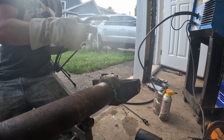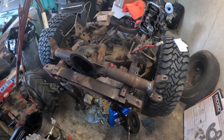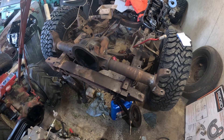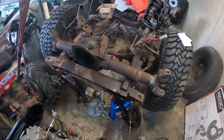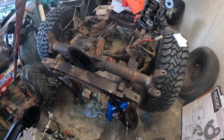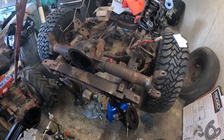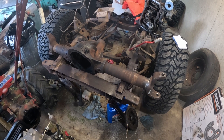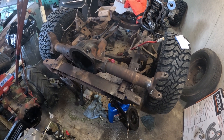I'm just going to rotate it to the other side and give it a tack there too. There we go — there is our Dana 44 shortened down. It'll be 53 inches once I've got all the other hardware on. I really did not believe how short this turned out — that pumpkin looks gigantic. I had to come move it over and double-check my math, but yeah, that should work. It's going to be a monster. The plan from the beginning was to just tack this and take it to a friend's with a 220 welder. I laid down the most garbage tack and told myself I could do better — and at the end of it I was all the way around, and it turns out I couldn't. So I ground all that off in shame and we'll take it to him and get it done right.